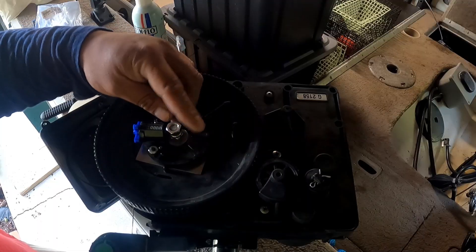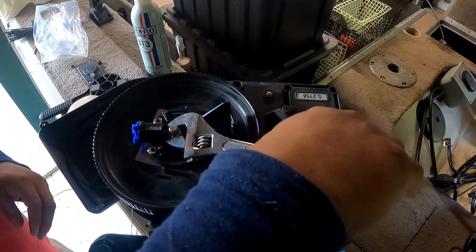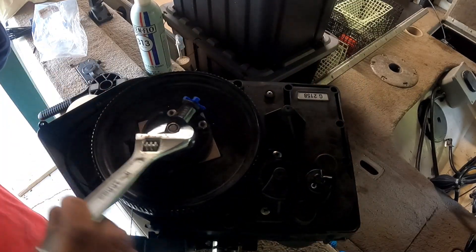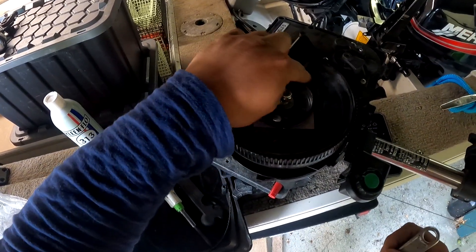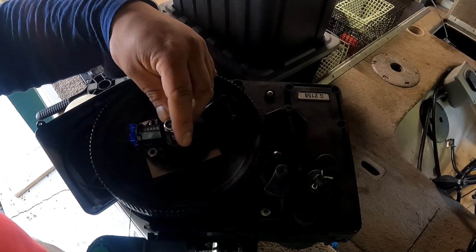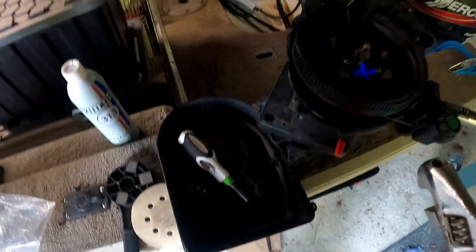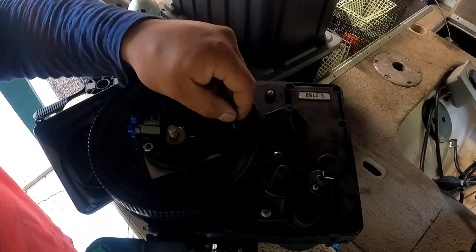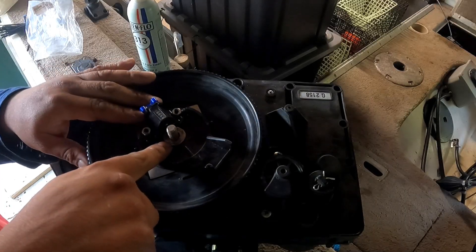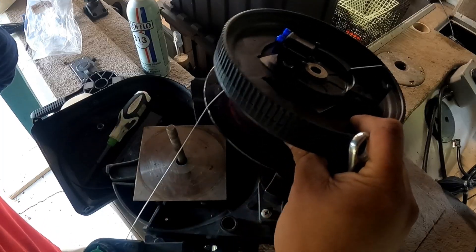Up next, we're going to be taking off our top nut right here — this is where your wrench comes in handy. Take a turn around until you get it off. It's a well-designed unit; you can tell they thought about letting you freewheel this. Here's that nylock nut — this is actually your brake adjust. It's a nut with a nylon insert right there to prevent it from being undone. Put that in your bin. Don't forget there's also a washer. Conveniently, they have a spigot right here, perfect to hold our unit.